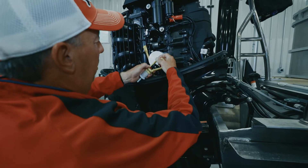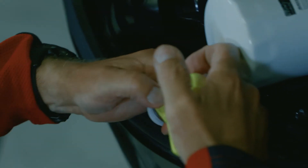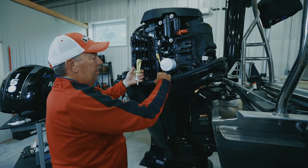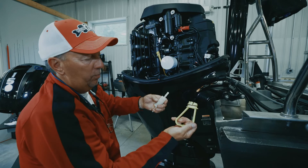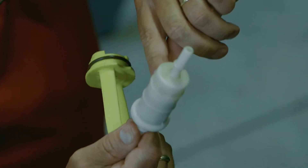Now on the top portion, simply push back in on the red button, pull it off, then remove the handle that allows you to get in and out. You can see the fuel filter is kind of dark.